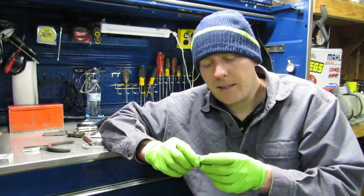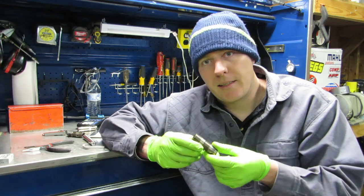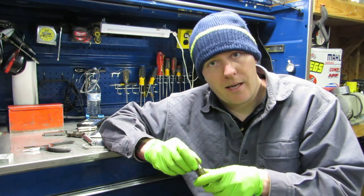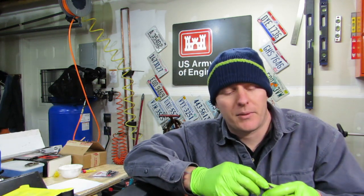Again, when these are working properly, they're nice and quiet. If you have plenty of lift and you're not worried about squeezing every bit of lift, I'm going to set these to 90 degrees — basically take out the tolerance out of the push rod, then turn it another 90 degrees, so I ensure I'm within the tolerance inside the tappet itself. Thank you guys for watching this video on hydraulic tappets. In our next video, we're going to go over rocker arm geometry. These are roller rockers — we'll talk about proper push rod length and setting preload on these hydraulic tappets. Please subscribe and feel free to watch our next video. I create these videos just to help people who don't understand what's going on or maybe want to build an engine for the first time. It's just people sharing knowledge and that's what I'm about.